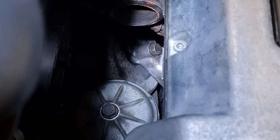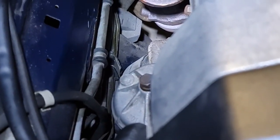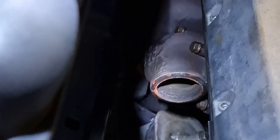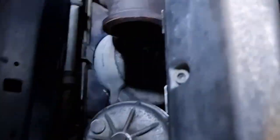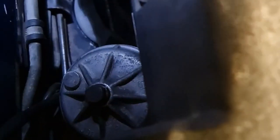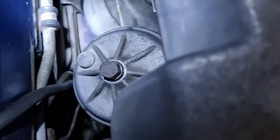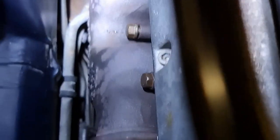with a good ratchet spanner, ring spanner, and then two downpipe exhaust bolts are tight. So we're doing from underneath to the top because we are now closing this gap by putting the last piece of manifold here. Still, the exhaust manifold bolts are loose for me to put that last piece on, and then I'll go ahead and tighten them up.